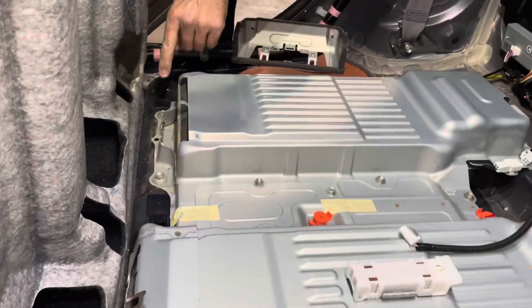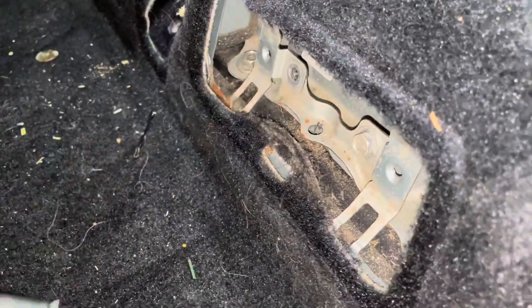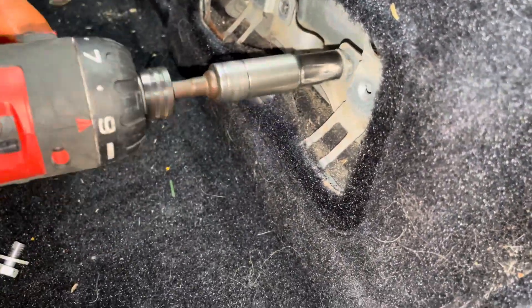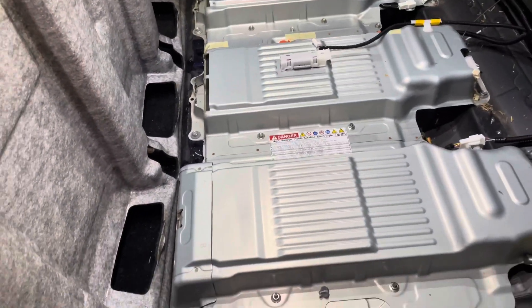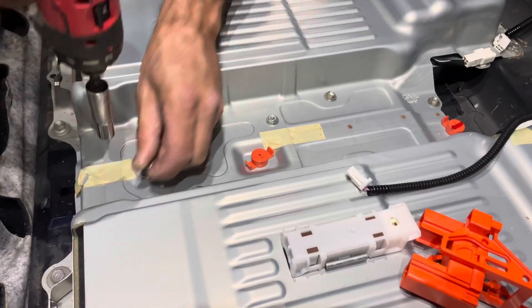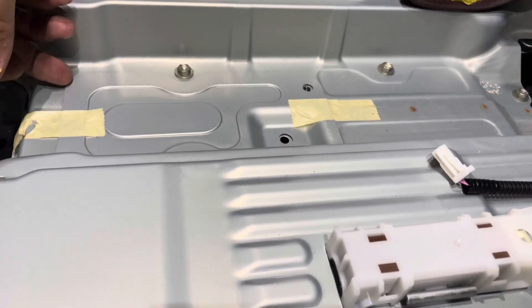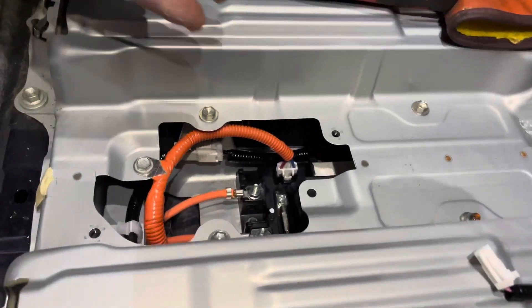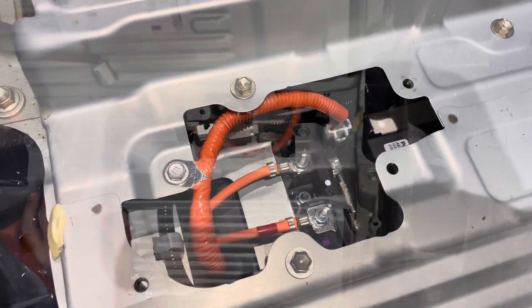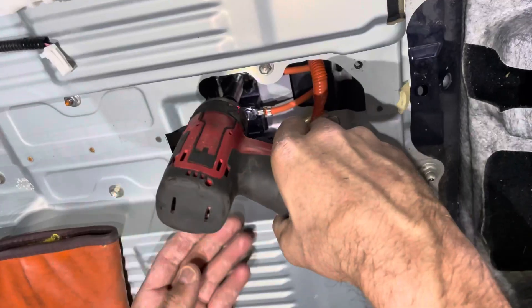Just to show you — this comes off and exposes our mounting bolts. Now we're actually going to disconnect the battery — one, two screws, 10mm. Once it lifts up it comes right out. Now lift up on this panel and you can see the two main contacts coming into the battery. I tested the voltage and made sure there was no voltage at the battery so I can feel comfortable taking these two 10mm bolts out.